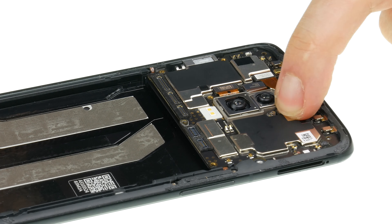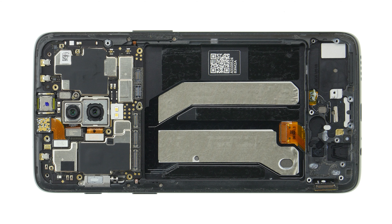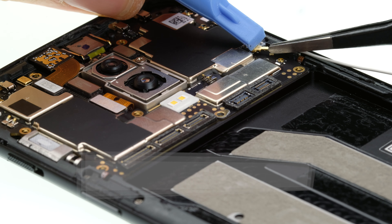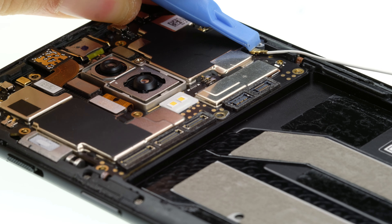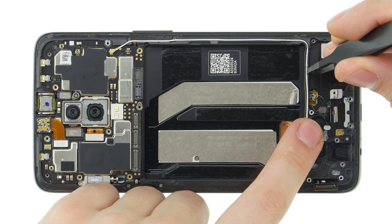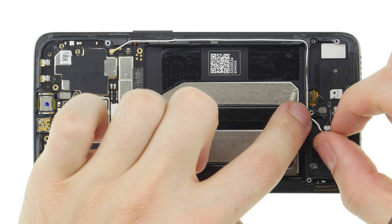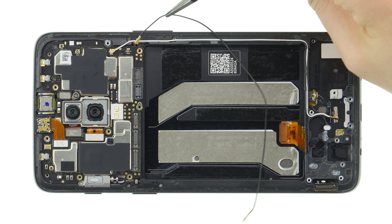Connect the connector of the proximity sensor. Insert your SIM and SD card and slide the holder back into the device. If the SIM holder is stuck and cannot be inserted properly, then the mainboard might not be sitting correctly yet. Now put the two antenna cables back into the device. Start with the white cable and connect it to the mainboard. Position the contact with a pair of tweezers and press it down carefully. Insert the antenna cable into its guide and press the silver sleeve into the clamp. Then connect the black antenna and lead it into the guiding and then over the white antenna.